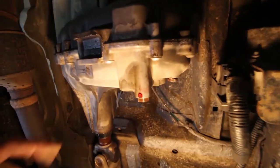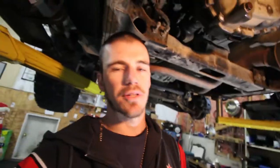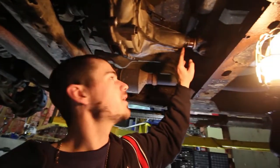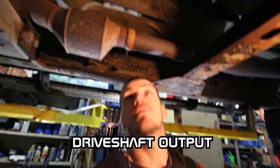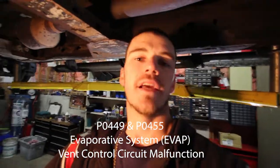Next one - under here the transfer case. You can see it's cracked and it's leaking fluid right in there. I'm gonna pull that out, polish it up, and maybe give it a weld - weld it back together. While we're on the transfer case, this output shaft seal is leaking as well - the drive shaft output shaft seal. I'll replace it. Super easy - I'll pull the rear drive shaft, pop that seal out, hammer the new one in.